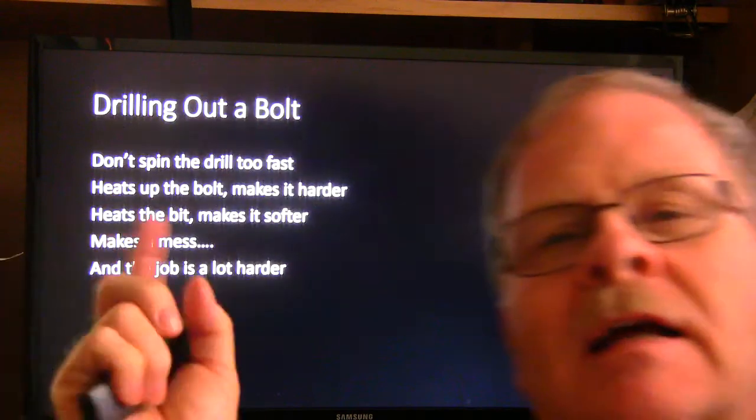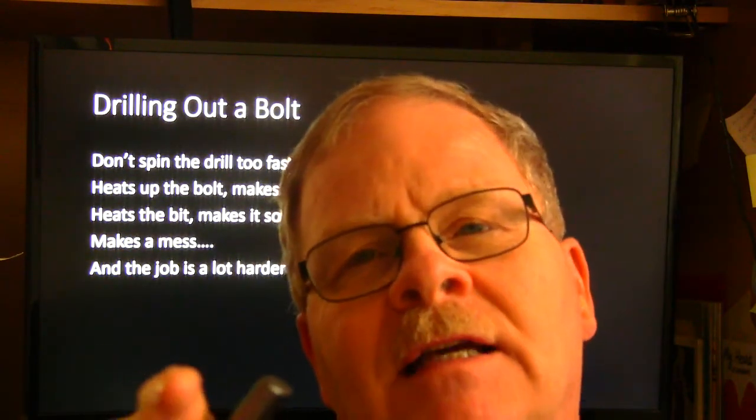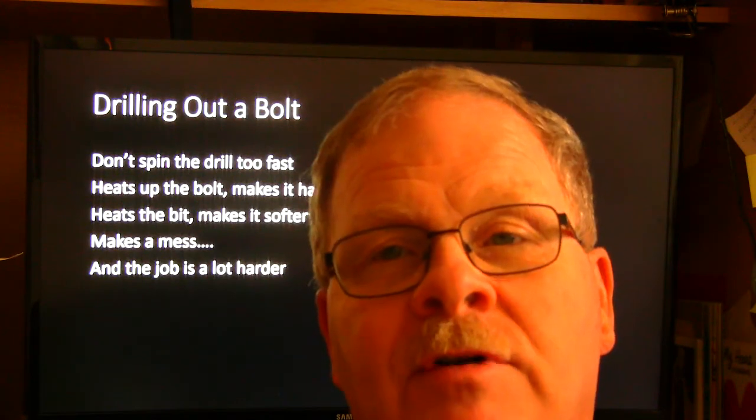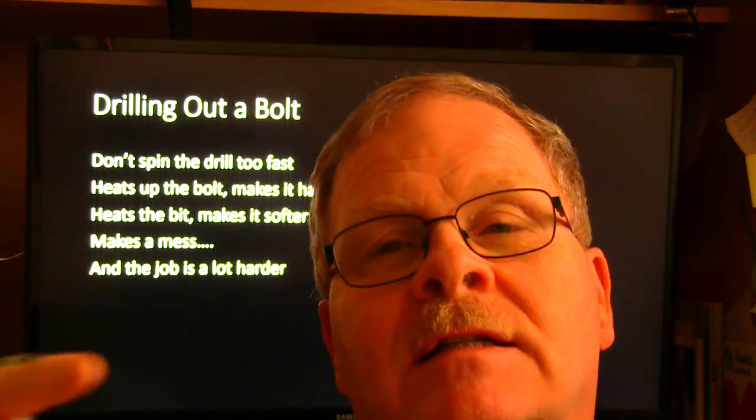But remember, like I was talking about the air drill, don't spin the drill too fast, because what happens is it heats up the drill bit, it heats up the bolt, and it actually makes the bolt harder, it tempers it, and it makes the drill bit softer because it takes the temper out of it. So you got basically a lose-lose situation there.